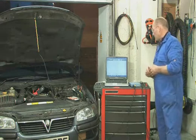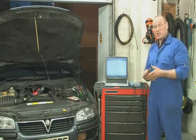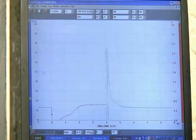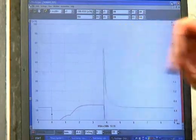David, if you can fire up, please. The attenuator is still in, and we need to use the attenuator because this is an inductor or coil. Now running live — you can see the image is running live. The triggering channel, the actual pulse, is channel A in blue. The actual fuel delivery period is clearly displayed between the grounding of the power signal to the point where the injector is switched off, and you get this back EMF, which is one of the critical diagnostic measurements we can observe. It's because of that that we use the attenuator so the whole thing fits on the screen.